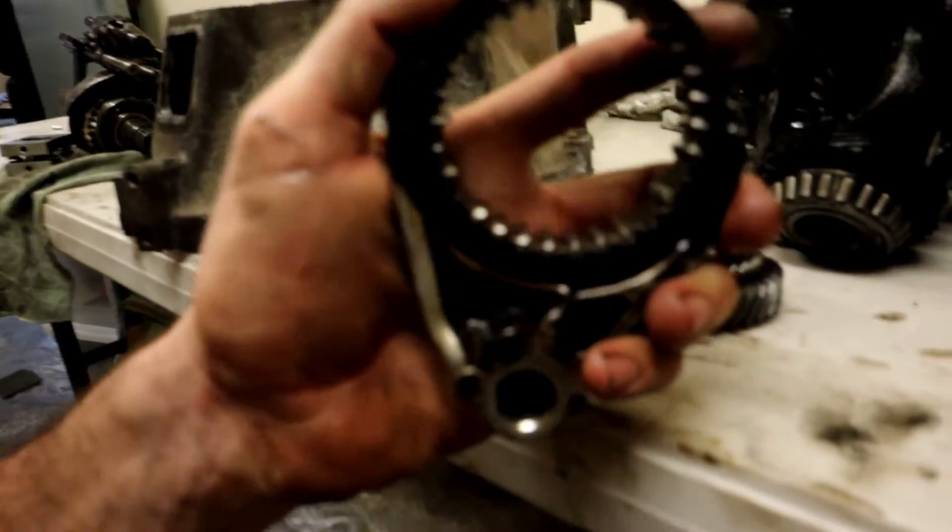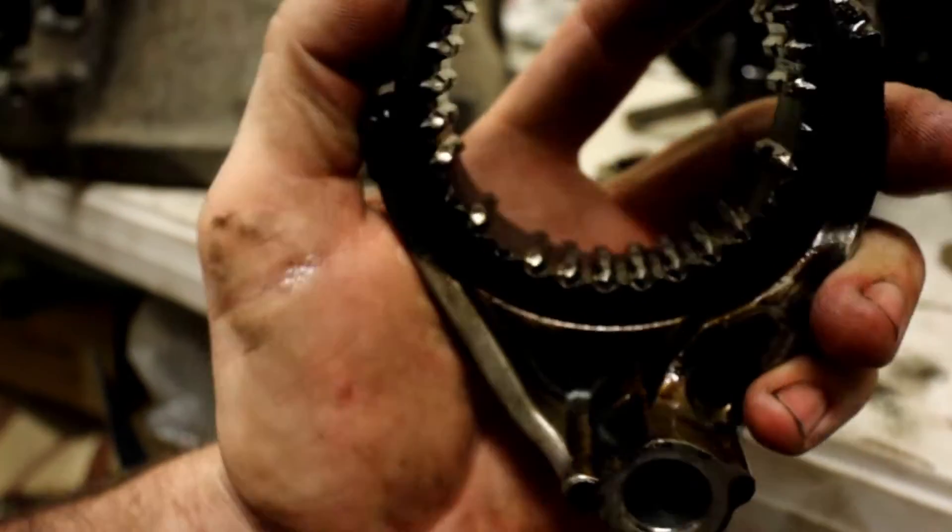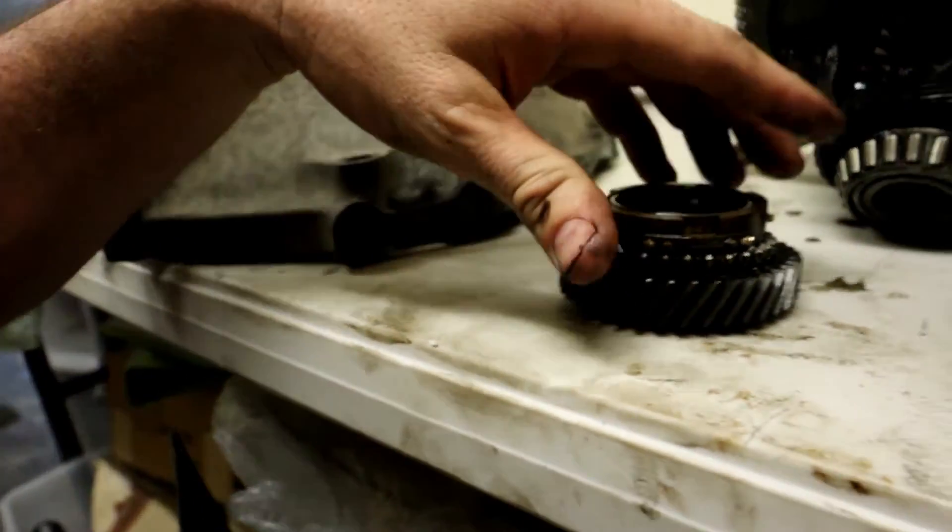Apart from my lack of maintenance and the gearbox being low on oil — I think there's about 100 mils in there — that's the reason that fifth is flogged out. We'll have a quick look at the synchro ring here and you can see all those shiny spots are where it's worn down, same as the synchro itself, so fifth gear is just going to keep falling out. You can just change the synchro and the ring if you wanted to. I've already put another stock gearbox back in the car so we could completely strip this one down and have a good look at it. But otherwise guys, this is the end of the third episode in the series of the cheap LSD gearbox. If you have any questions, pop them in the comments below. I'll also put links to episode one and two — if you're interested in putting one in your car, I highly recommend having a look at those. Alright guys, we'll see you in the next one.